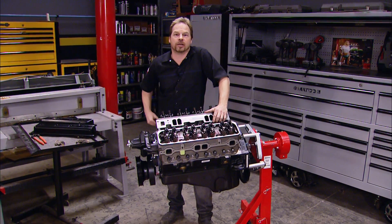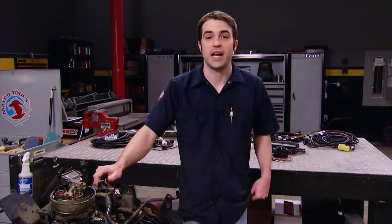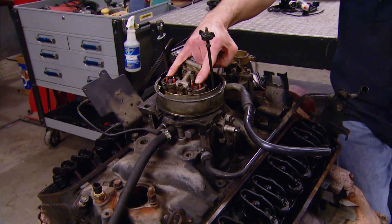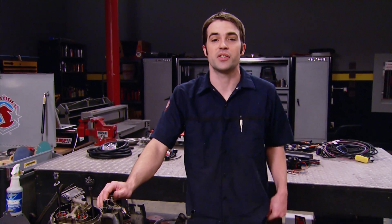Plan B: we've got to wait for delivery and get a new set of aftermarket valve covers that will clear the rocker arm setup. No harm, no foul — we didn't waste money, we just have to spend a little more. Now, there's one thing we haven't talked about on our new 383, and that's the fuel injection system. The EFI on our old 350 was just a TBI system with two injectors in the throttle body. While it's a decent system — it got this truck to 260,000 miles — it's just not that receptive to performance modifications.